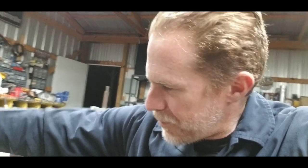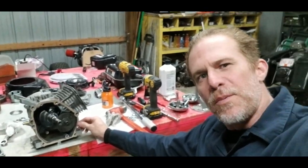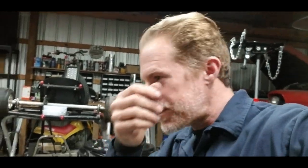See here, I'll go ahead and set this on there so you can take a look at it. It is pretty much the same thickness. There you go. Put a little bit of silicone on that, torque it down, and be good to go till you get a new one. Or if you're like me, you'll just run it. But anyways, I'll go ahead and get the side cover on now, get everything torqued down,